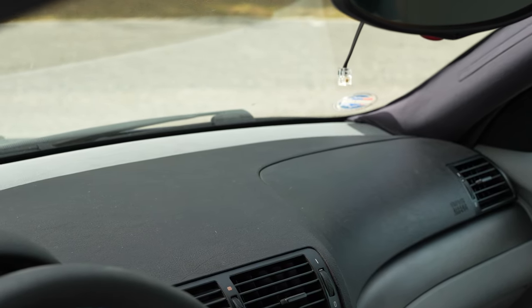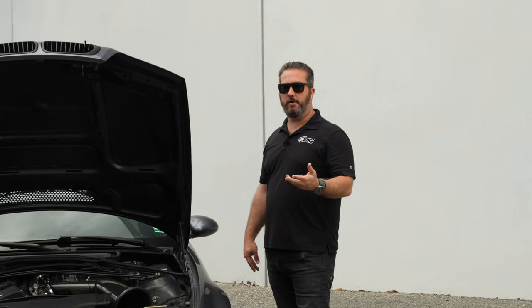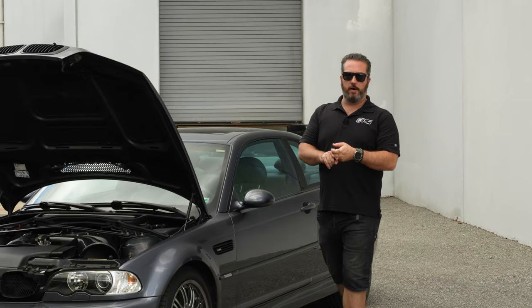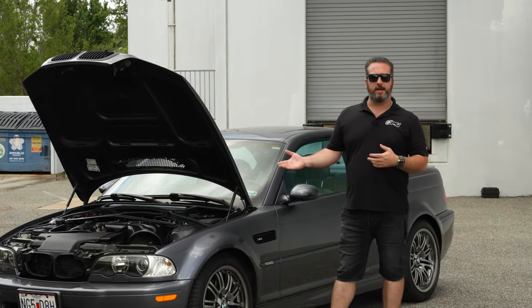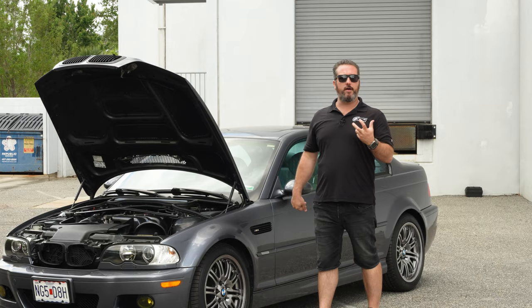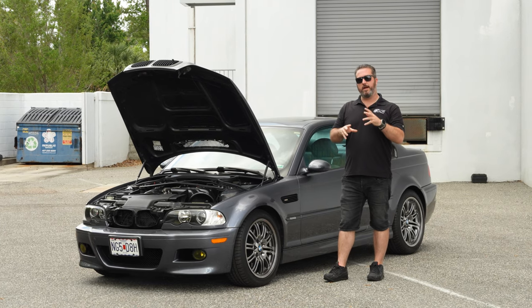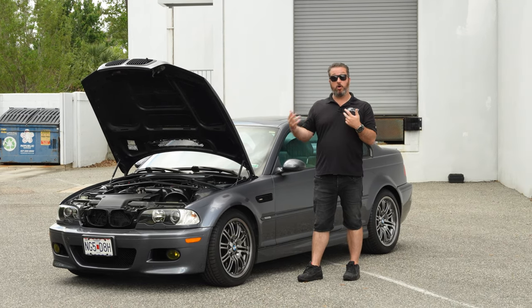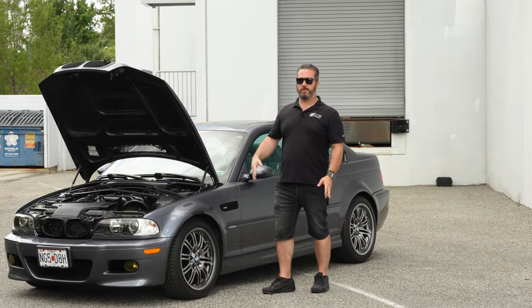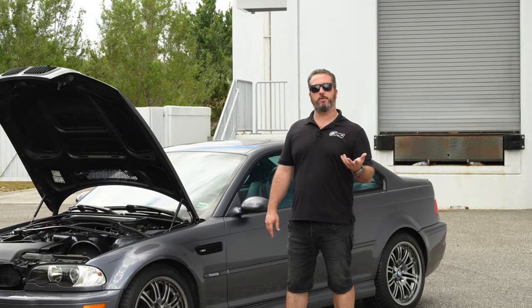I work with Carl down at Active Auto Work — he's OG, been doing this for 40 years, longer than me. He knows what he's doing, especially with these airboxes and all the race cars we build with S54s — the E36 that we built, the E30 that we built. Those cars all run the airbox on Alpha N. We ended up changing the tune to an Active tune and checking over the O2 sensors and a lot of other things. What we found is that the O2 sensors — there are four of them — had actually been swapped. When the car was worked on, they were taken apart and put in the wrong places on the OE headers. The car runs with those swapped but does that idle search. We were able to find the issue, fix the O2s, put brand new O2 sensors in the car, retune it, and that's when we made 331 horsepower to the wheels on the dyno.